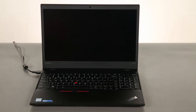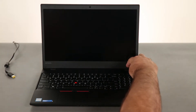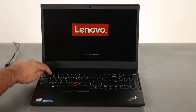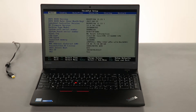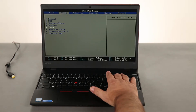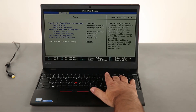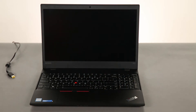And now that we're ready, let's get started. First, we need to disable the built-in battery. So I'm going to disconnect the power adapter, press the power button, and tap the F1 key. Once the computer is in setup mode, navigate to the config menu and then down to the power menu. Hit enter. Navigate down to disable built-in battery and hit enter. Hit enter again, and the built-in battery is disabled.